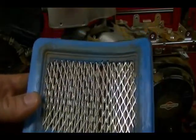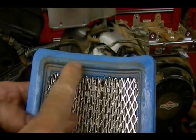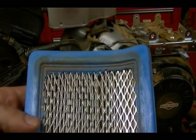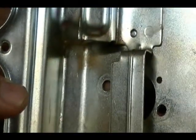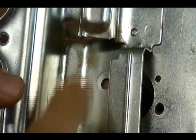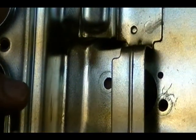Here's the side of the air filter which should be clean, and you can see that there is dirt here. You should never see dirt on this side of the filter — this is evidence number one that dirt is getting into the engine. This is the inside of the air filter housing, and you can see there's dirt there, which is evidence that dirt is getting past the air filter.